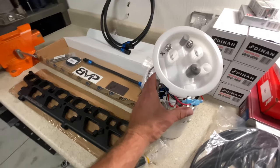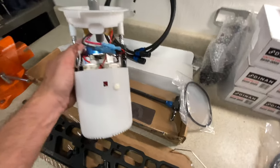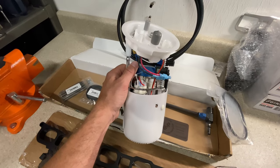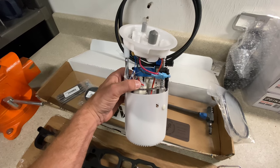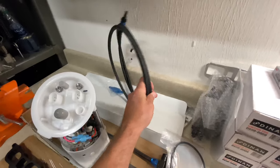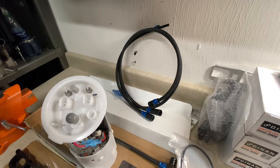Now, as I briefly mentioned, this is my low pressure fuel pump. This is what was on back order for about a month and a half. This is also from Black Market Parts. This contains 2 450 Walbro fuel pumps. In the back here, you'll notice this is a new fuel line that will run to the driver's side of the fuel tank.